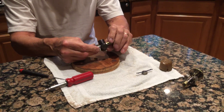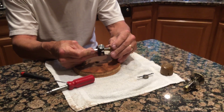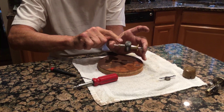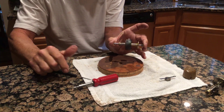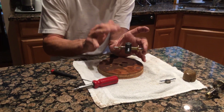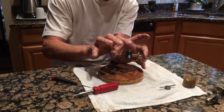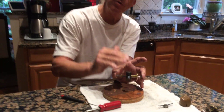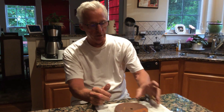Before assembly, you want to make sure that you oil the shaft. So when you get it all together, that's how they should run, just like that. When they're running in the machine, you can see the top of the governor, and you shouldn't see a governor weight coming up like that, or you have a weak spring. This isn't complicated, but this is my tip for the day.